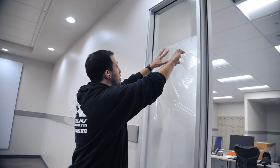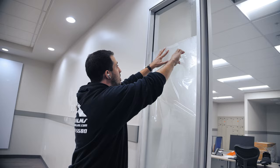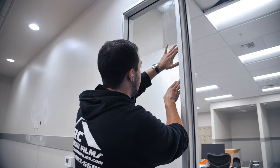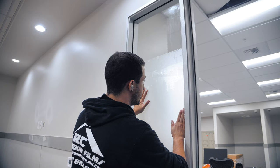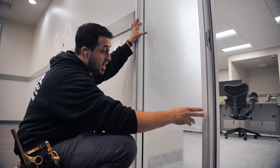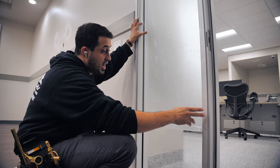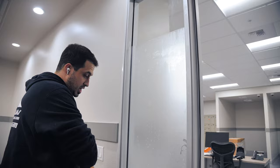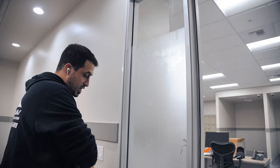I'm going to peel my liner off and expose the film entirely. One little trick with this — because we cut this off of the film handler, it's really nice doing a band because we know for sure that it's perfectly straight. So I put the straight edge on this side, lined up my mark that I'd already marked earlier, and I'm setting it making sure it's lined up on both sides. Once I have this perfectly straight, I know that my entire panel is straight.